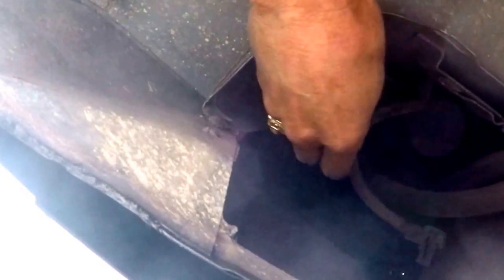We're going to remove this 10 millimeter bolt on the edge of the frame and then drop this whole unit down. We need to unplug the electrical connector — we've already disconnected the battery so we're good there. Now with the electrical connector out of the way, it's just the one 10 millimeter bolt. We'll drop it down; we may also need to disconnect a hose, and if needed there's another 10 millimeter further back holding that hose against the frame.